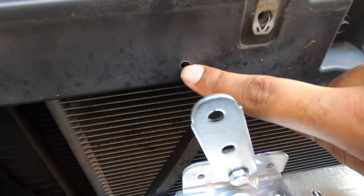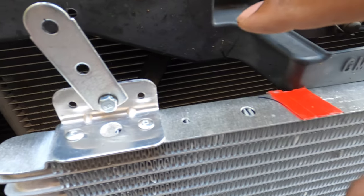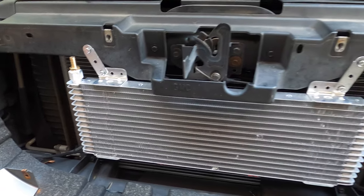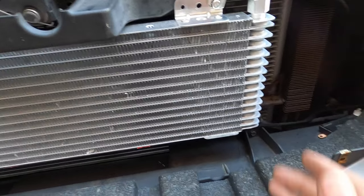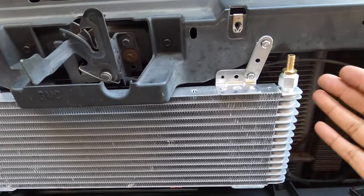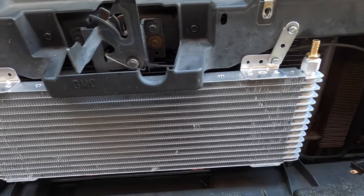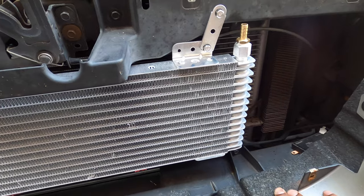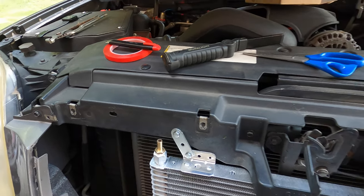As you saw, we drilled the holes in the radiator support, then we cut down the brackets, beveled the edges, and got them bolted onto the transmission cooler itself. Now let's get this bolted in. There's a slight change — the barbs are now up instead of down. With this length on this specific truck the bend was not going to work facing down. From my googling it does not matter if the barbs are up, down, left, or right. With the grill on there should be just enough bend radius to keep it below this point, so we should be good to go.